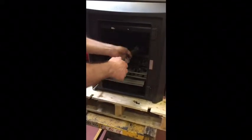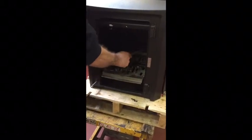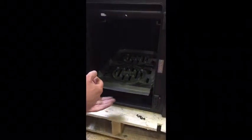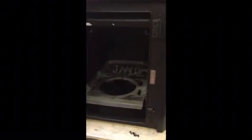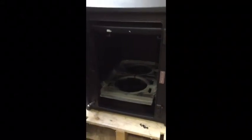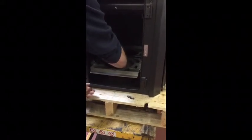Remove the fire fence bars. Remove the front riddling grate by lifting the right hand side from underneath the grate frame to disengage from the grate linkage. Repeat for the back riddling grate. Pull the grate linkage back into the firebox until the riddling lever clears the front casting.